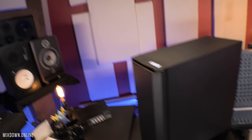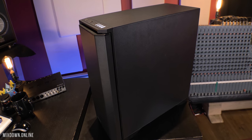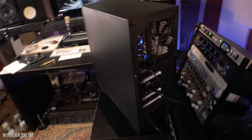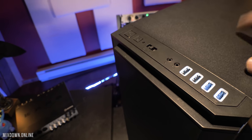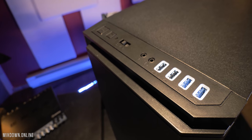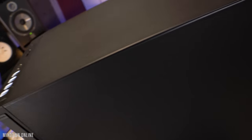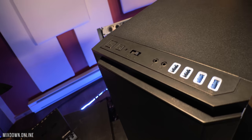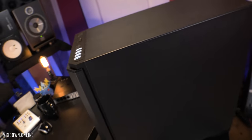Now the final product — and this is what we get. It's a very nice computer. Very nice computer — it's pretty much silent, it doesn't generate a lot of noise, which is actually pretty impressive. If you look here on the top of the computer, we have different speed settings for the case fans. We can put it to the maximum speed, which then the computer is going to generate way more noise, and that's pretty normal. This is where I have the three front fans, and there's one at the back of the computer as well. I can bring that down to the lower setting and completely no case fans running — running on only the CPU fan — which makes this computer very, very quiet.